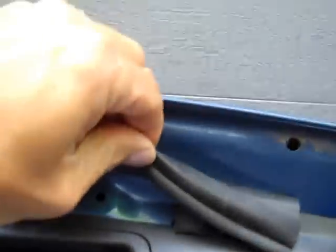To get this latch out, first thing you want to do is pull these plastic fasteners — plugs, whatever you call them. They're just fitted in there. Most of you have probably seen these types of plugs before. You've got to be careful pulling them out — you can break them. I'd get a couple screwdrivers in there, one on each side to pry it up, then get a fatter screwdriver on the other side and they'll pop out. There are four of them, and getting those out lowers the bottom part.